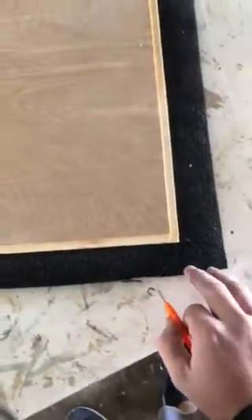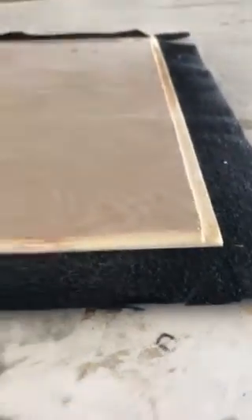Pro tip for wrapping carpet trim panels or anything like that. When you're wrapping a corner — say this is a trim panel for a console — to get nice edges, go ahead and cut everything before you start spraying glue. You'll save a little bit of time and hassle. Also, this routered edge, this little step down, makes all the difference when wrapping these.